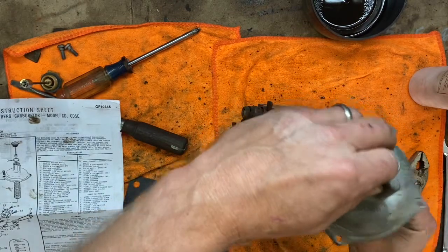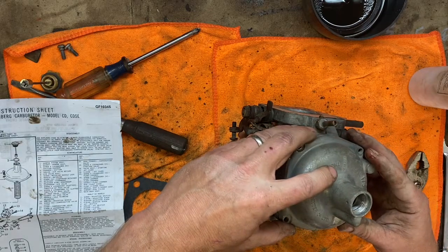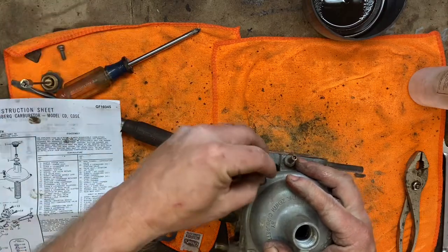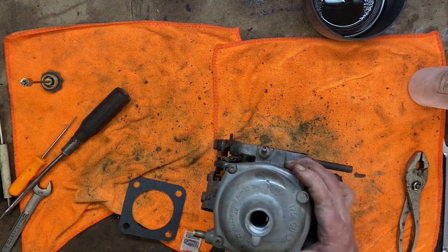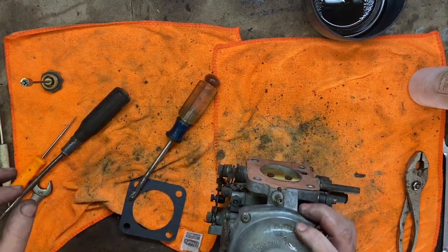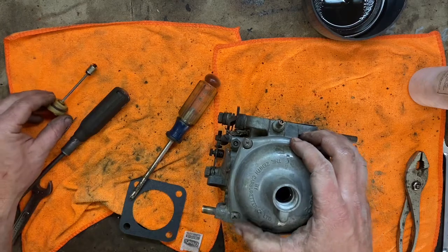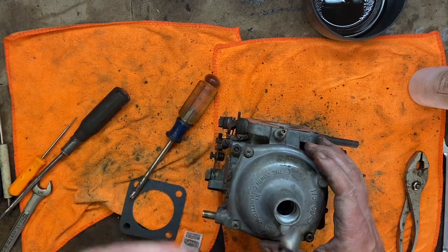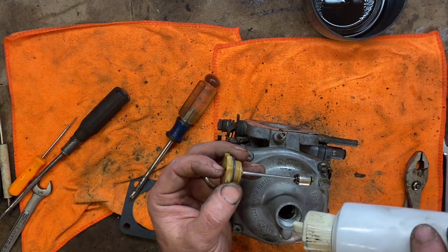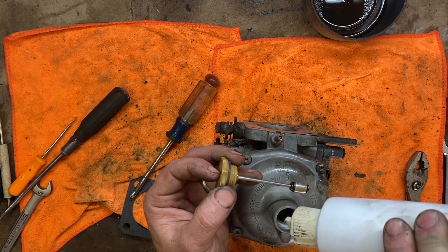Okay. Make sure the spring goes there on the outside of it. And there you go. Nothing moved. Got that aligned. I'd have to look up a YouTube video. I'm sure you probably should do so as well, to maybe help you understand how this whole setup works. And then the inside of this is supposed to get filled with oil up to 1/4 inch of the top. This is a damper. I don't know how I'm supposed to determine 1/4 inch from the top. But sure, let's do this.